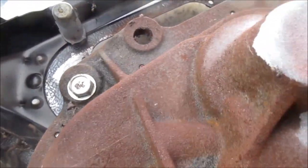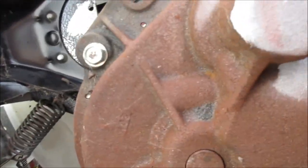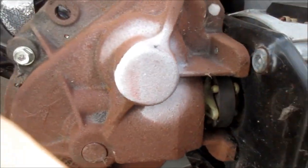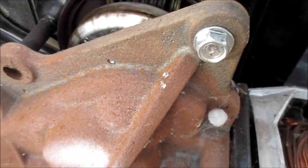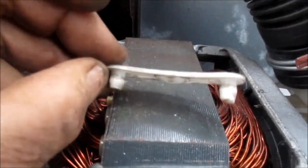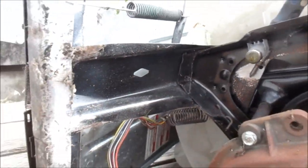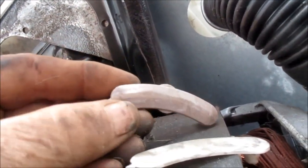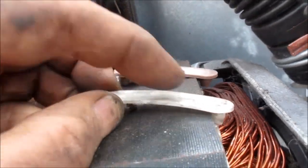We may lightly sand it. The drive coupler has some wear but it's still good. The clutch is actually weeping some oil — it could be slipping, but I believe the story was it was still working okay. Here's the old snubber — it's pretty well flattened out. I wedged a screwdriver in there and pounded them out. The newer one is rounded and beveled on top; this one's flattened out. It's fairly worn and has some oil on it.